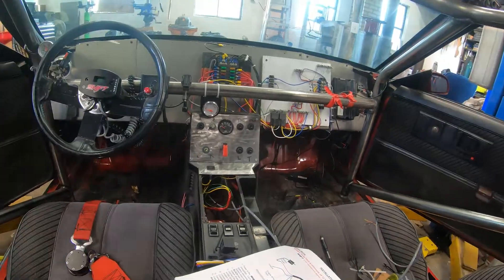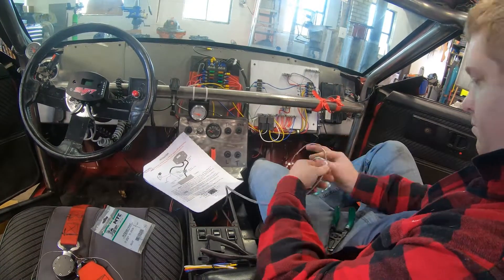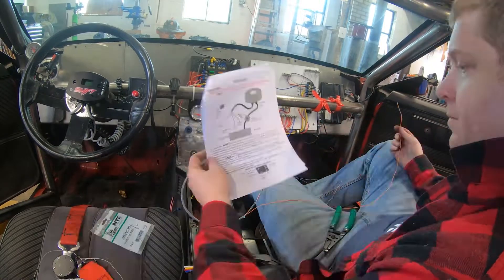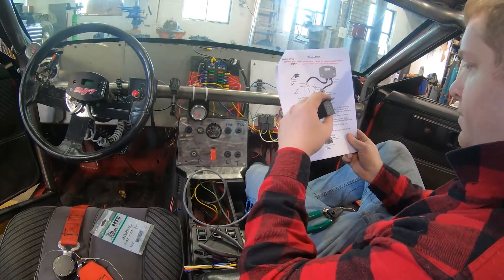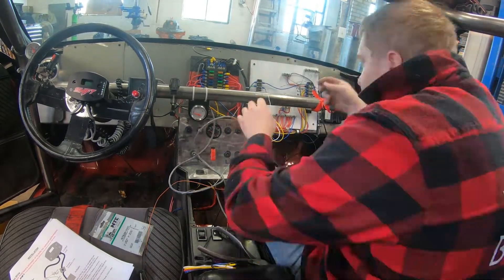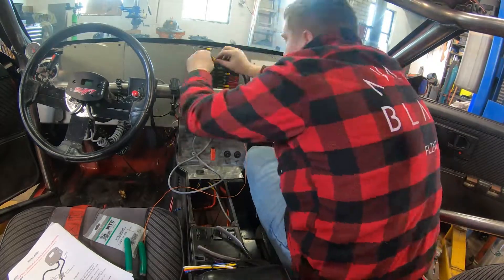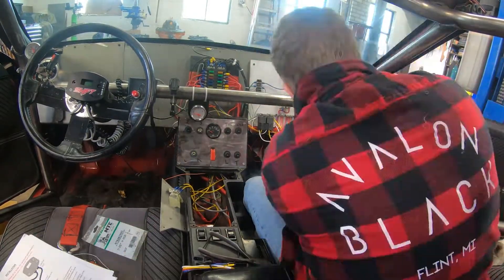This also has a neutral safety switch feature so you have to wire that up to a relay and to your ignition key. In my case I have a momentary switch that does that. So we now are wiring that in place so that we actually have a working neutral safety switch — that way we can't start it while it's in gear.